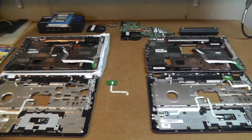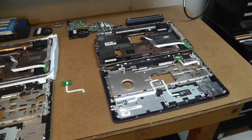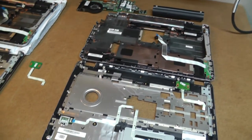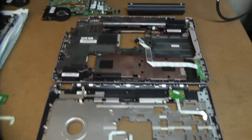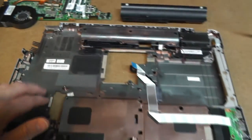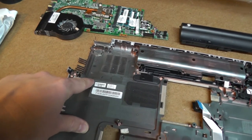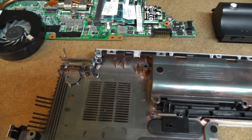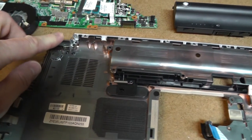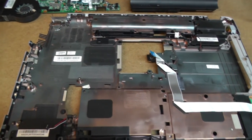Before you know it, you're committed. A laptop computer that someone gave to me — it was an HP 17-inch — had a couple problems with it, so they bought a new one and said they don't know what to do with this. It's from 2010, but it's a nice 17-inch computer. The problem was, as you can see back here, this is the base of the computer where the fan and the heat sink for the motherboard were, and this whole section was gone because the hinge where the flat panel monitor went in got real tight and ended up breaking out the hinge section and the grill for the fan. The whole back of this case is gone, and it's a well-known issue for this HP model.